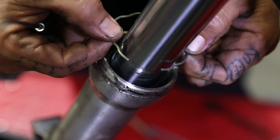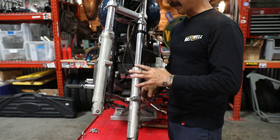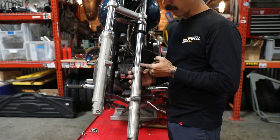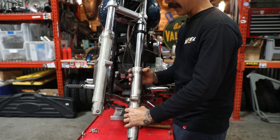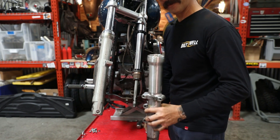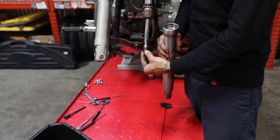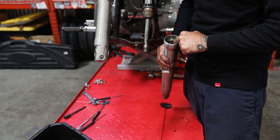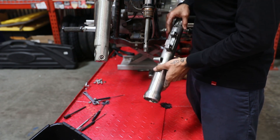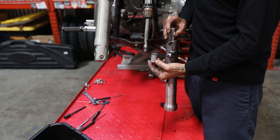Once you've got the clip off, gently pull everything off the bike. Now that the clip is out, the last thing remaining is the fork seal — we need to get this out of the lower by banging it down until it releases. This is your dampener rod. There should be a cap on the bottom of that; more times than not that cap stays inside the fork lower. To get it out, turn your fork lower upside down and tap it on the table — and it pops out. That's what you're looking for.